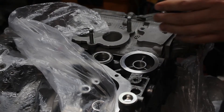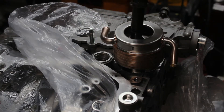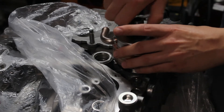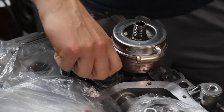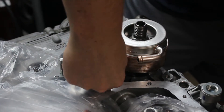While I waited for the order to be ready, I installed the new oil cooler. There were some metal fragments in the old one and they can't really be cleaned, so I had to cough up $300 for a new one. This also isn't only a cooler — it's meant to help heat the oil and maintain it at a consistent temperature. Some people delete this, but I'm keeping it, especially because I live in a colder climate.